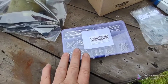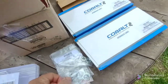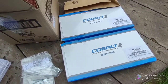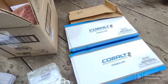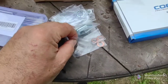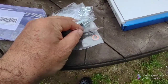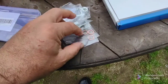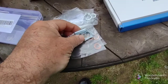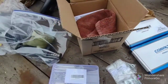Here's a nice cotter pin kit - cost about eight dollars with all different sizes so you can get the right one. I'm also doing the two front brake lines for the MGB - the rubber hoses - because you can't tell if the old ones are good since you can't see the insides. Here are all the fittings. They had two different size copper washers; you only need one per side so I'll use either the two small or two large ones. There are also internal tooth lock washers, some brackets, and two new nuts.